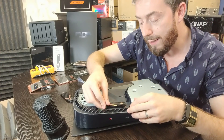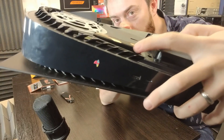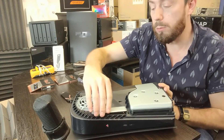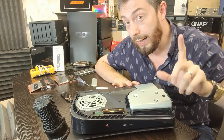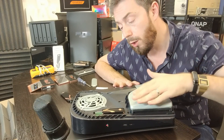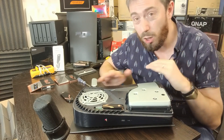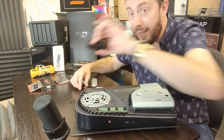This is Sabrent's own Gamer heatsink — a big, large heatsink. If you install that in there, it raises the volume height of that heatsink quite significantly, and the result is you couldn't possibly fit the panel on top. There's a contention about how good or bad that is, because on one hand air passing over that heatsink is no longer contained, but on the other hand you've now created a bump which may affect airflow through that vent. There are arguments on either side, which is exactly why we're talking about this PS5-designed heatsink.